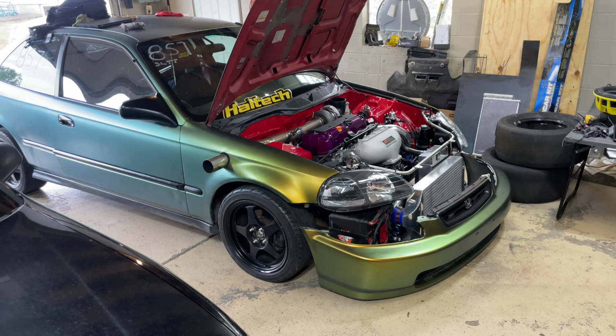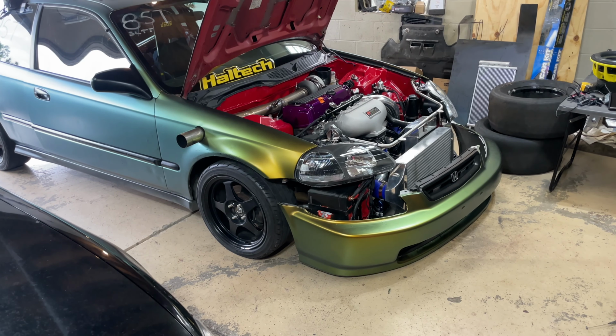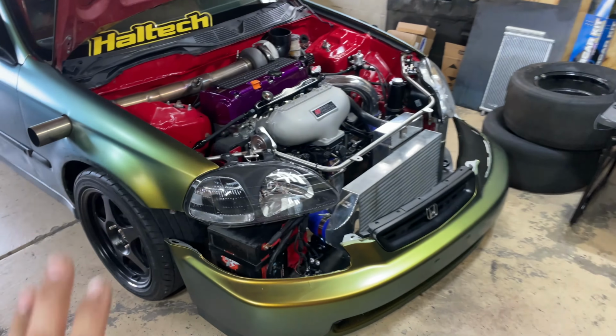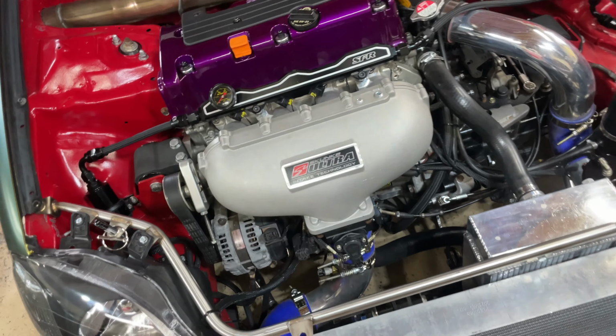We're doing race car prep. Today is Tuesday. We have an event Sunday, private track rental. Well, my local O'Reilly's rented the track. My whole family's coming. So we're gonna do a few things on the car to get ready. We are going to pull apart our fuel pump, make sure it's clean, clean our injectors.